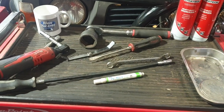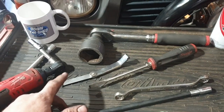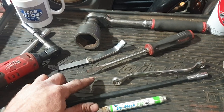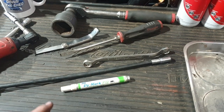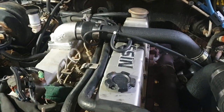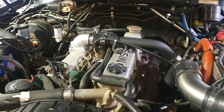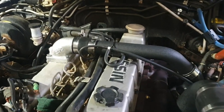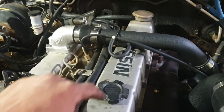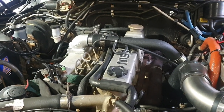These are the tools I used for the job — basically the only specialised stuff you need: a 41mm socket to turn over the crank, and some feeler gauges. Your basic tools — flat blade, offset spanner, and socket set — will get you through. A magnetic dish is handy to throw everything in. Rocker cover back in place, air intake reconnected — time to start it up, make sure it's all sweet. A little tip when doing up the rocker cover: start in the middle, work your way out, back to front, opposites. They only have to be done up hand tight, just nipped up — otherwise you'll pinch the gasket.